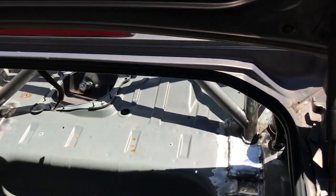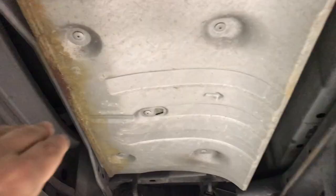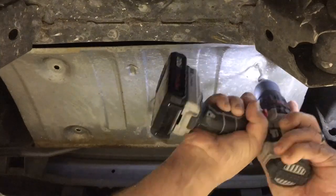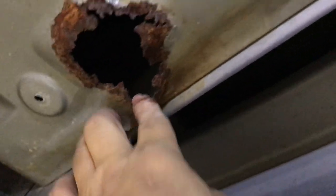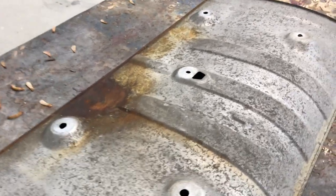We've got a little bit of stuff we've got to repair. There's a little bit of rust damage back here we've got to repair and then paint all of this area. We're going to try to take this heat shield for the muffler — we're going to drill these rivets off and get this piece off, and I'm going to try to use this as the patch panel for the rust repair. You can see it's rusted through here, and this little panel has some of the same indentations, so I think this panel is going to work pretty well.